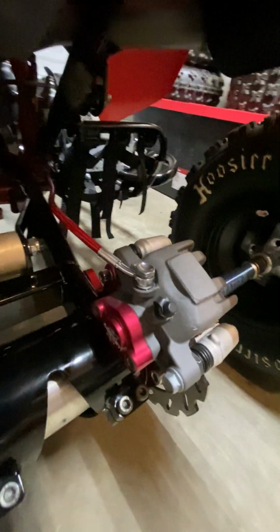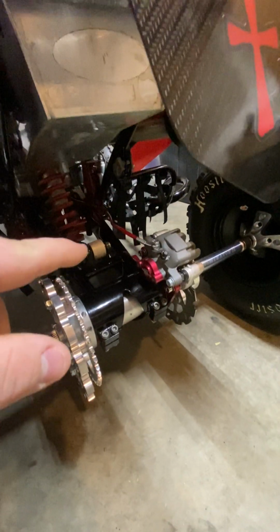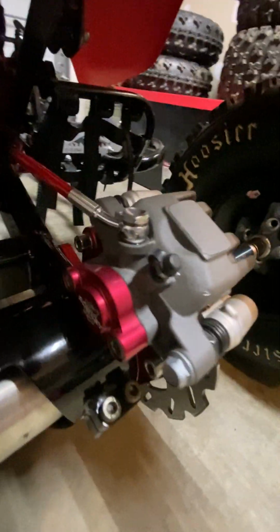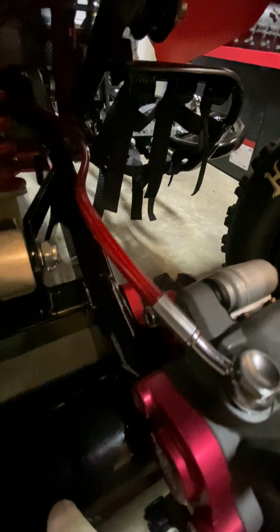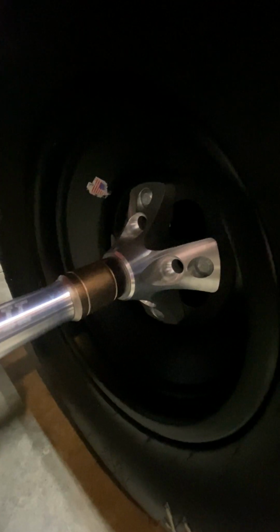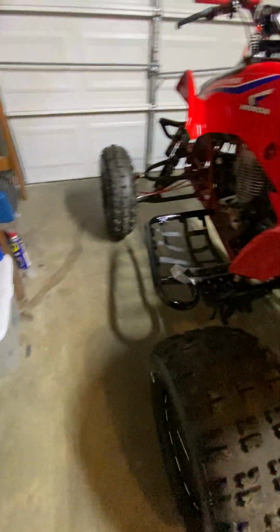And then it has a 450R OEM, but all the brakes are OEM 450R brake calipers, and they're all brand new. That stuff from Rocket, and then it has the Rocket brake mount brake caliper, and then we have a BVC axle nut to complement the brake disc, so I can run the 450R style setup. And then the back here we have LSR billet hubs, and then tie it off.